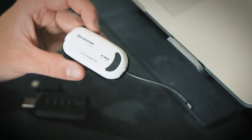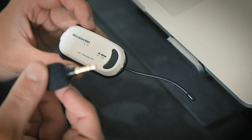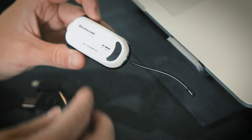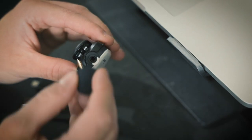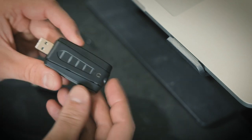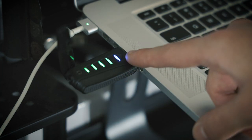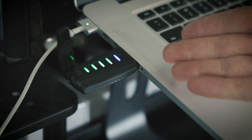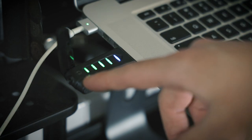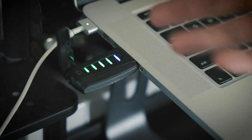I have my MacBook Pro ready to go. First thing we've got to do is plug the microphone into the transmitter — I'm going to be using the little eighth-inch mic right here. You can also use the one with the longer cord if you want to clip this onto your belt, but for our purposes I'm just going to use this little guy. We're going to plug it into the microphone input right here. Then we're going to turn this on — little blue light goes on. Then we plug the receiver into our laptop via USB. You have these lights show up: the first light shows the receiver is receiving power, and then the four green LEDs show that it's successfully paired with the transmitter. You can also plug in headphones to monitor the signal, but we're going to be recording into the laptop directly.